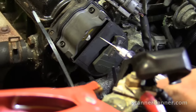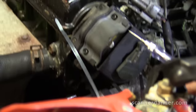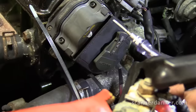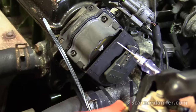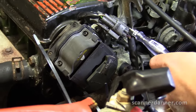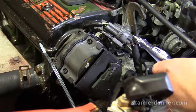This is going to be the test of all tests, and really you could have done this from the get-go. Once we found the tach was bouncing and smelled fuel, maybe all we had was a test light and a paper clip — we could troubleshoot this car with just that. Though if that was all you were using, you'd have to confirm battery feed to the coil, which we confirmed based on this coil current ramp test still on the screen.